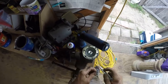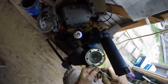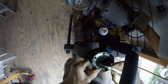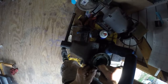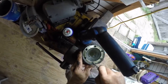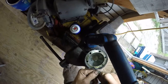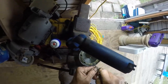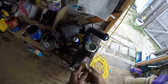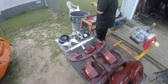There's a broken-off bolt on the axle. I don't know if you've ever used one of these — it's like an automatic center punch, spring-loaded. It's great for extracting bolts, especially if somebody bottomed it out and it snapped. You just keep doing that — it's kind of close to the center so it's having a hard time turning. Put a little PB Blaster in there — it's moving. You keep finding a spot you can dig into and it works. Try that if you haven't already. That's Kyle over there putting the pushrod tubes together.